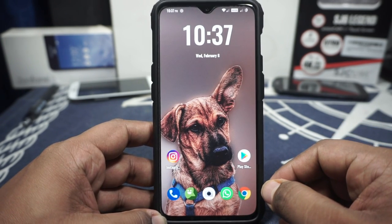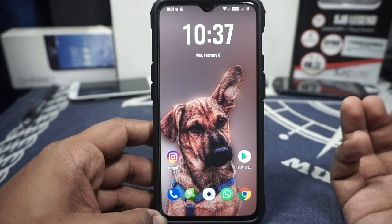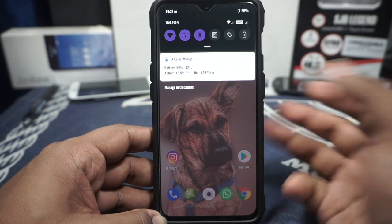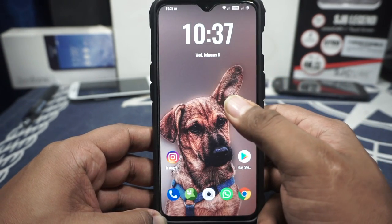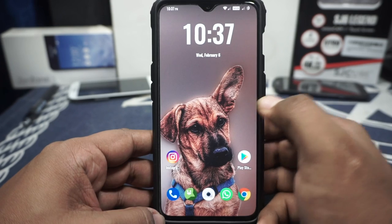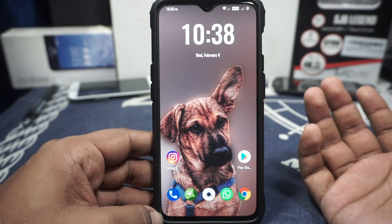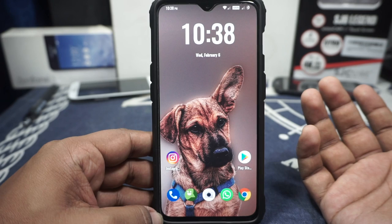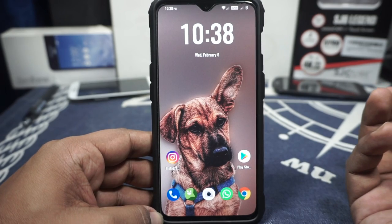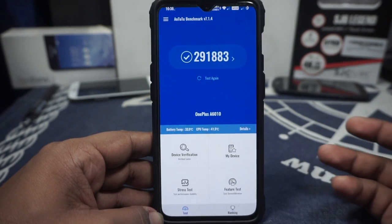As you can see it's a loaded ROM — there are a lot of features, most of the stuff works, and it's pretty awesome to see Resurrection Remix on the 6T. For battery life, let's say it's adequate — getting about 11% of active drain and about 1.5% of idle drain. On this phone I'm used to getting less than 1% idle drain and about 10% active drain, so it's a bit higher. Custom kernels are available and people report better battery life using them.